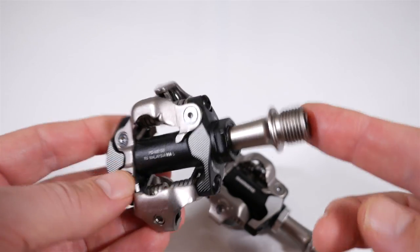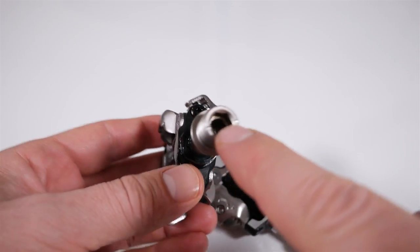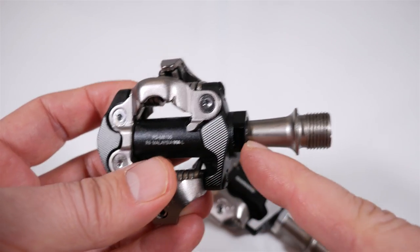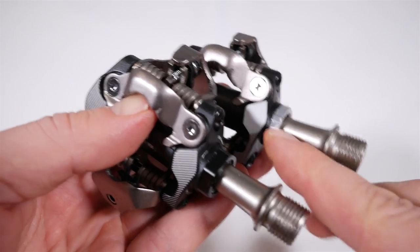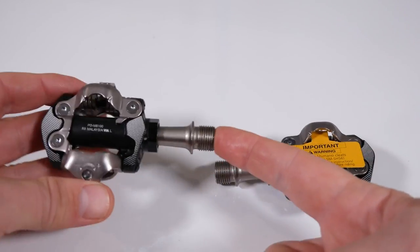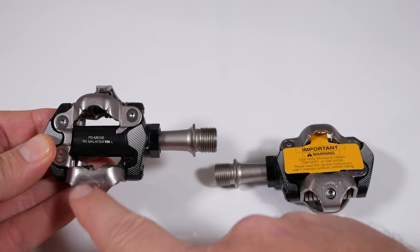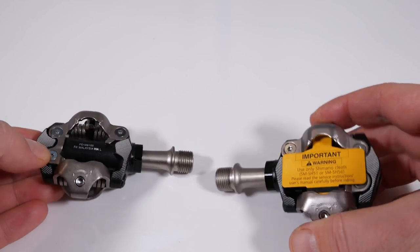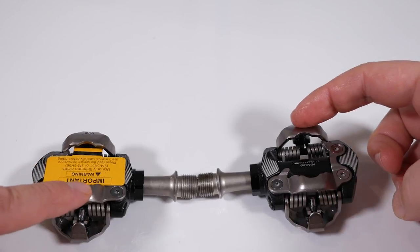This is special because it has a reverse thread, also signified by this cut or groove at the end of your spindle. The bearings are sealed and they lasted pretty well for me in the past — they seem to be again identical. An easier way to remember which is left and which is right: if you look at the pedal, you're going to have the adjustment screw towards the back of your bike, so this will always be left. Obviously if you have them backwards, that's not going to match anymore.